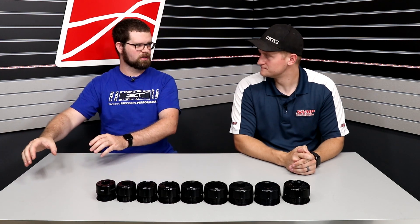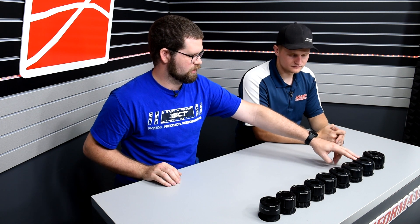We're talking about Coyote engines at optimal cam timing, at wide open throttle, at sea level, measuring boost at 7,000 to 8,000 RPM — with this pulley you will observe 11 to 12 pounds. Things like elevation, the type of exhaust you have, aftermarket cams and cam timing — all these things can change how much boost the car actually sees, and they will also affect power. This is why we're not going to get too in depth with dyno numbers, because that's a whole separate set of variables: different dynos, different elevations, uncorrected versus STD versus SAE versus JIS and all the other correction factors. So 88 millimeter, 93 octane. If you have 91 and you're really confident in the quality or you're running a boost cooler, you could run an 88, but if it's just 91 octane, stick with the 92.